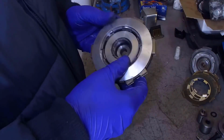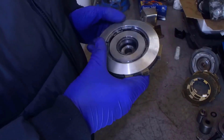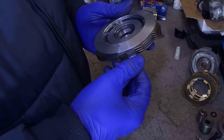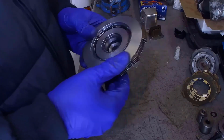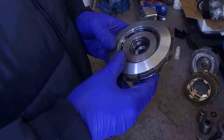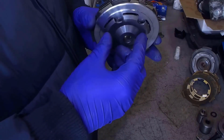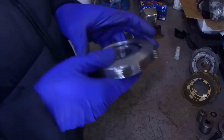Let's finish with the clutch. This engine will mount a clutch made by Fabbri, and as you all know, it mounts Falk type discs. This one specifically was used just in one 12 hours long race, but we'll change the discs anyway just to be safe. Let's take it apart.